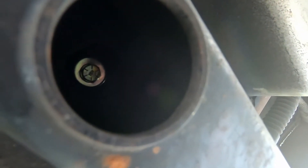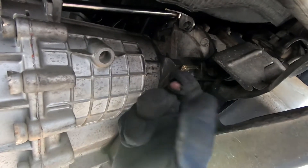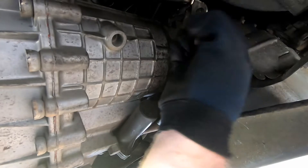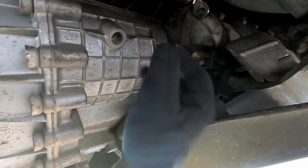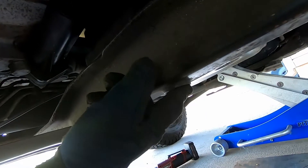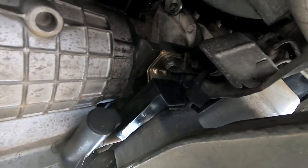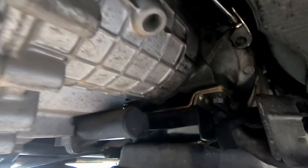That's pretty much the finished product. The bolts from Energy Suspension come with a locking washer as well as a regular washer, so it goes: big washer, locking washer, then the bolt — stuck through the hole and tightened down. I torqued those bolts to 30 foot-pounds, and the transmission-side bolts torqued down to 36 foot-pounds. The install is finished.